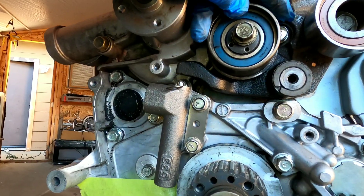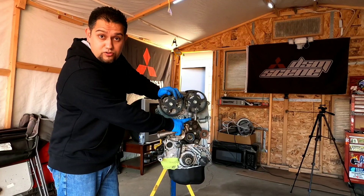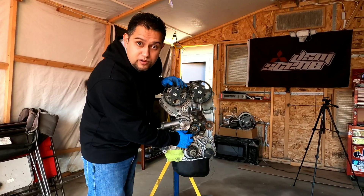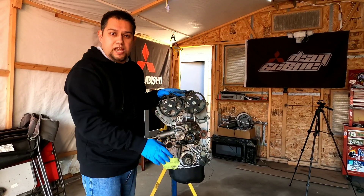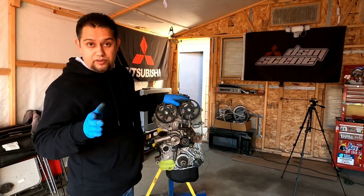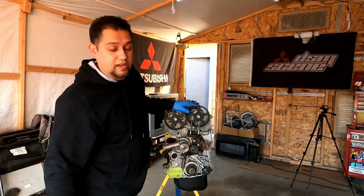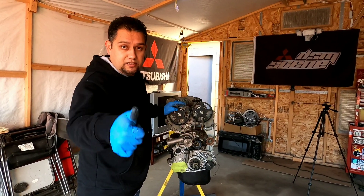In conclusion, you need a 2G motor mount bracket modified to fit the six bolt, you need the 1G tensioner arm, you need the six bolt tensioner, and everything else — all the other timing components — should be the same. I'll be doing a video on how to do your timing belt and I'll also be installing another goodie for my buddy George. Stay tuned and I'll catch you guys on the next one.